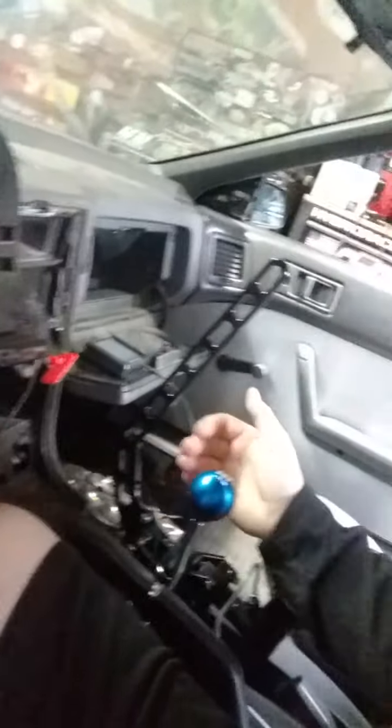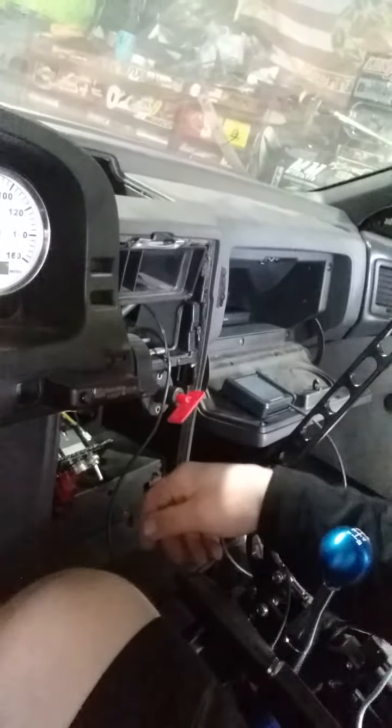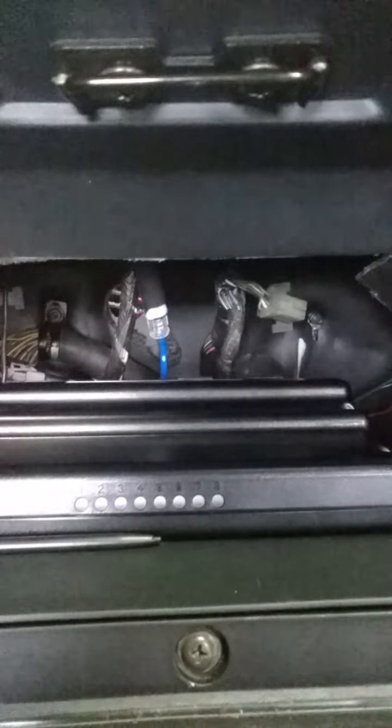I'm going to give you guys a little rundown of the start procedure. I'm in the car in neutral — let me shake it 15 or 16 times to make sure it stays in neutral. We've got our kill switch on. Key on — just want to show you real quick, there's the Terminator ECU in the glove box. You can see one through eight LEDs when I turn the key on. Six and seven right now are green, which means they're ready to try to turn.